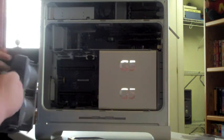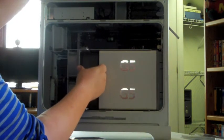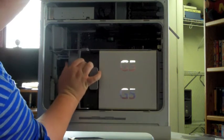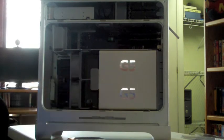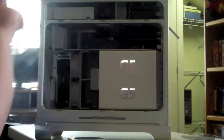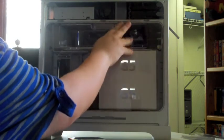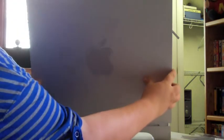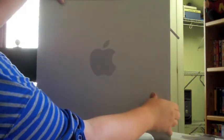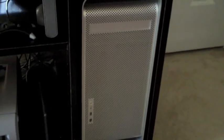So, go ahead and put the fan assembly back in. Just line up the grooves and push ever so slightly — you don't have to push too hard. The air guard goes back in. And finally, the cover. Push that in and push the lock down.